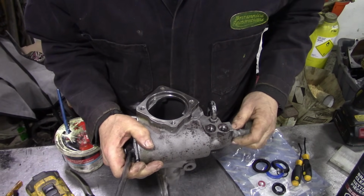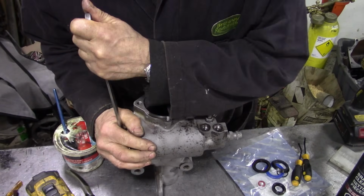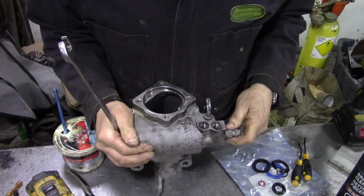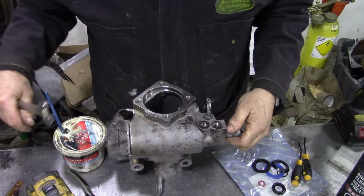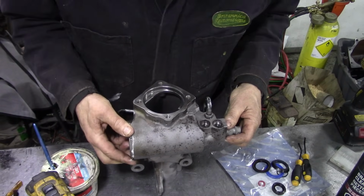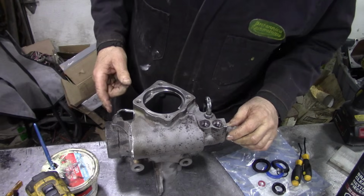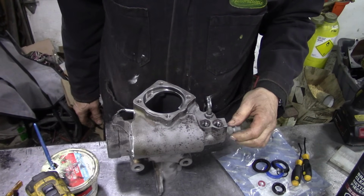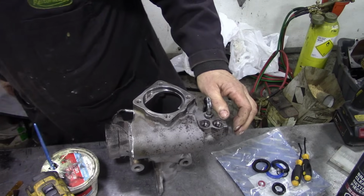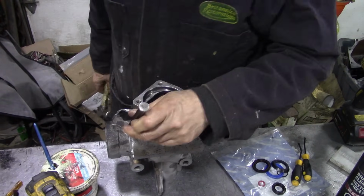Listen. Now, you should put a little bit of tension on here. That's too much. Back it off a bit. There, you hear it? I'm happy with that. So we've finished with that section. You're supposed to put a gauge on it and put preload onto it, but to be honest, I've tried all that, and by feeling these things here, you get to know when it's too tight or too slack. You don't want it too tight, that's the problem. Anyway, we'll hammer that up, I think, and just lock that nut up, lock that washer up.